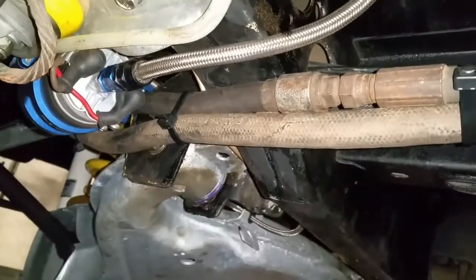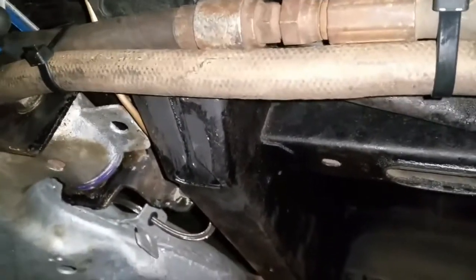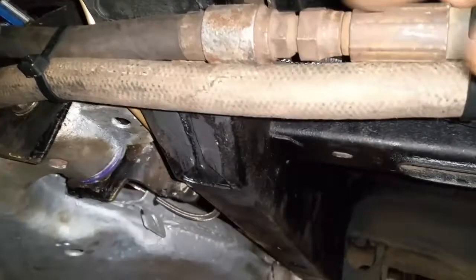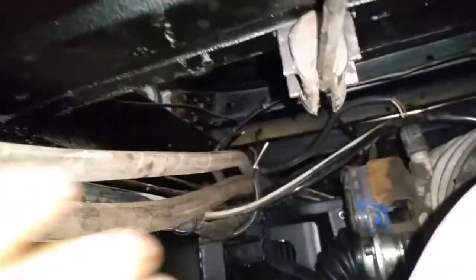The power steering hoses on the original donor vehicle were haphazardly routed and flopping about all over the place, so I had to decide where to put these. One came with a clip attached, so that's bolted up to the cross member that goes across the chassis. That's the pressure line and that's the return line — those are the original hoses. They wouldn't fit through the recess where the cables normally run, so I cut two holes and fitted grommets so they can run through there, then cable-tied them to the existing harness run which takes all the electrical and vacuum lines up to the rack.